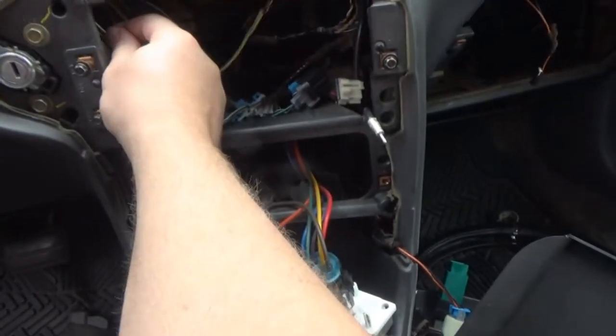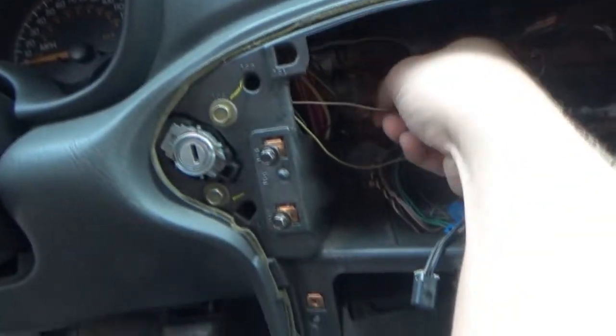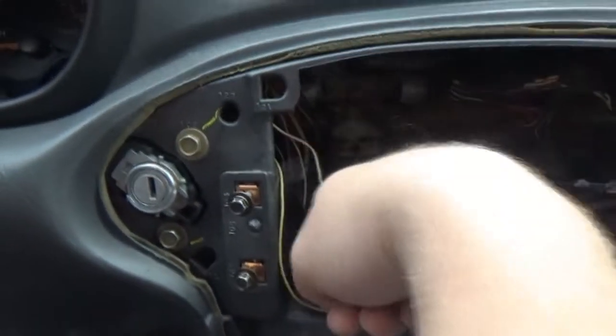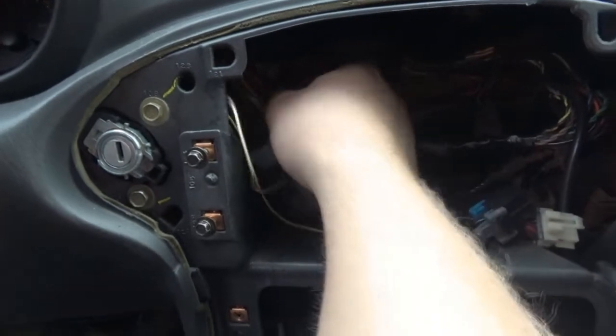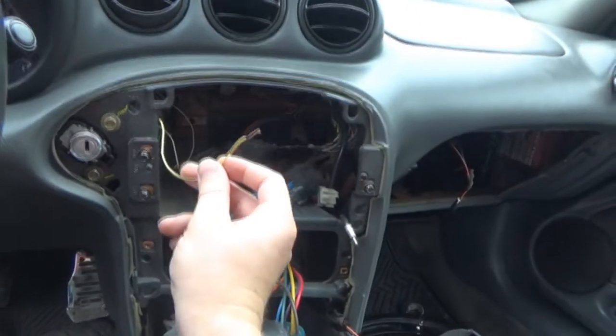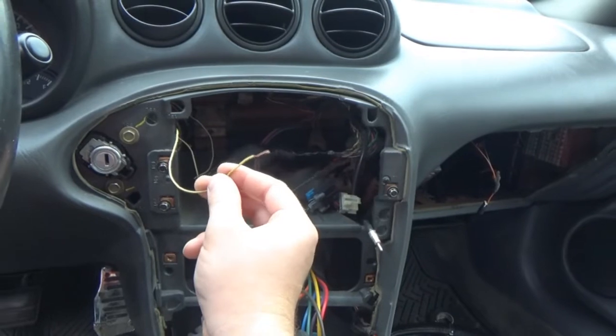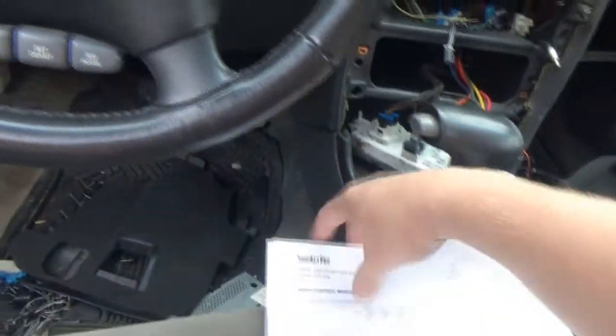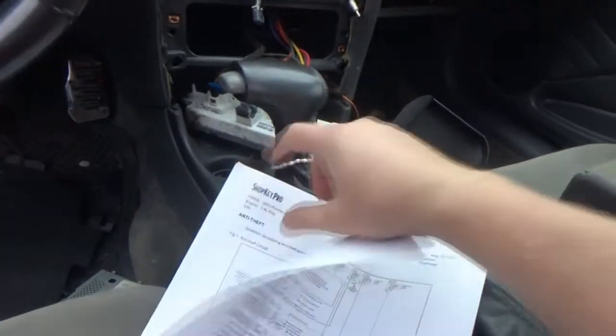They didn't touch this white wire. This white wire is at the back on top of the ignition, which is where the passkey sensor is. And yeah, this wire looks like it was untouched. The black wire, which is the ground signal somewhere, they tied into it, but for the most part, it is still intact. And like I said, this is the signal wire. This is the one that I believe reads the key and ensures that it's the right key to disable the immobilization. If I'm not mistaken, I do have a wiring diagram somewhere in this pile of wiring diagrams. Anti-theft.